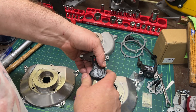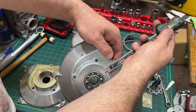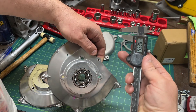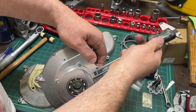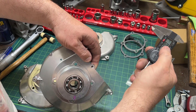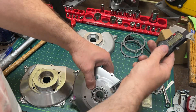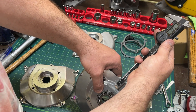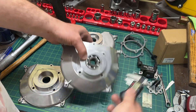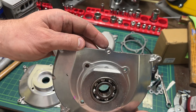And now the depth — all right, quarter inch. I need some better calipers, maybe some manual vernier calipers. Zeroed out — yeah, quarter inch. So I added a little extra clearance right there with the angle grinder, a little cutoff wheel.